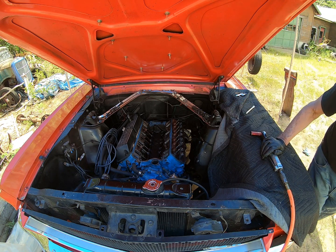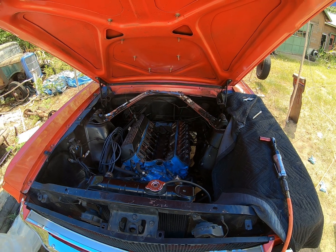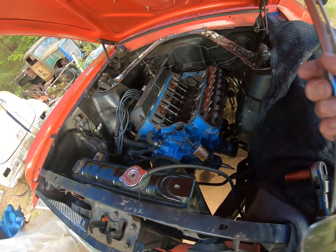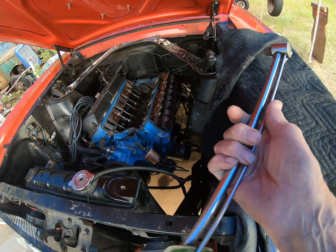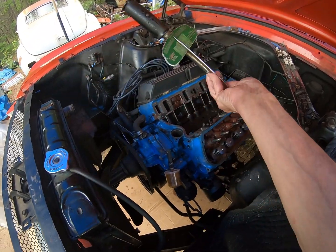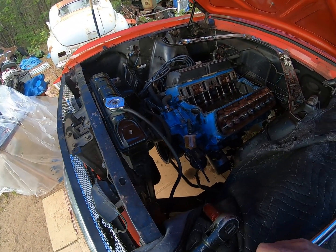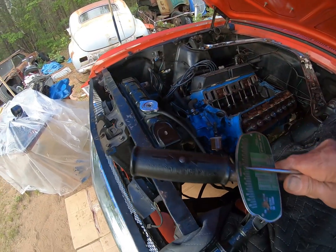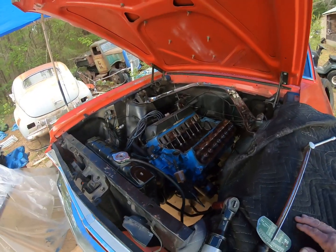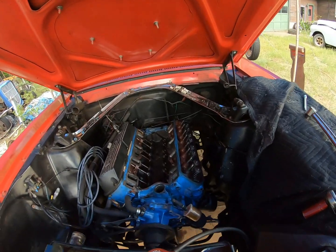Now they're all snug. I've got to find the torque wrench and the correct half-inch socket. I've got them partially torqued using this crappy torque wrench. Working from this side I can't really get enough push on it to get it to read 60. If I pull it from the other side I can't read the scale, so I have no idea where I am. I've got to get another torque wrench — Richard's got one that clicks, I need one that beeps. I'm going to borrow one of those to torque them down.